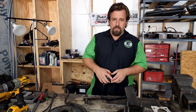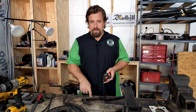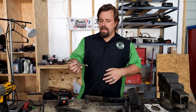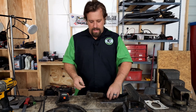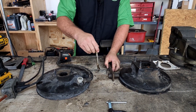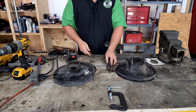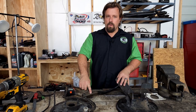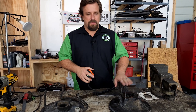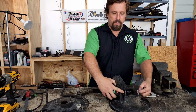What we're going to do is move our master cylinder pivot point up three quarters of an inch. This has a half inch bore, so we're going to take a half inch bolt and make a short bolt that we can bolt through the pedal, with enough thread sticking out to put a nylock nut so it doesn't fall off. And once we move that up three quarters of an inch, we're also going to want to move our master cylinder up three quarters of an inch as well.